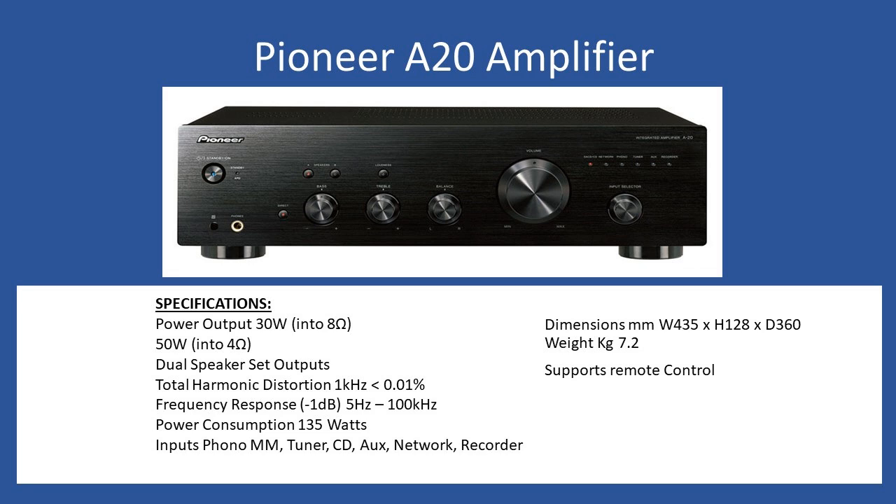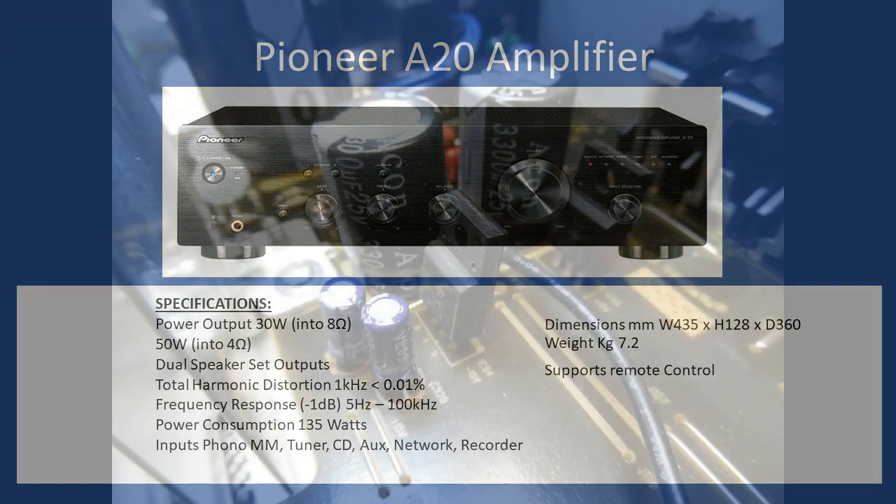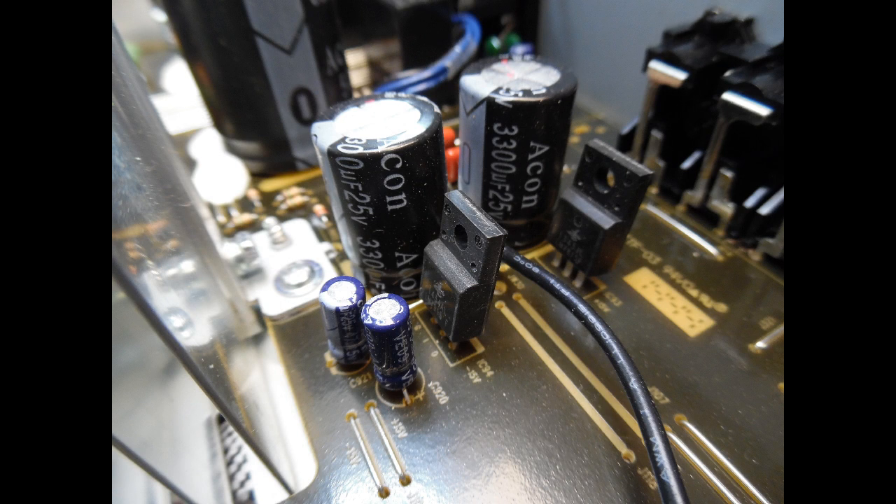Coming to the common faults that typically appear — probably the major one is what you're seeing in this video. The most common type of failure is the low voltage power supply regulators, which are a plus and minus 15 volt supply used to power the input selection circuit and pre-amplifier stages. These are made by the Korean Radio Corporation, or KRC. Sometimes you see the failure straight away — the customer may report a red flashing light on the power selection button, indicating the amp has gone into protection mode and they can't change it.